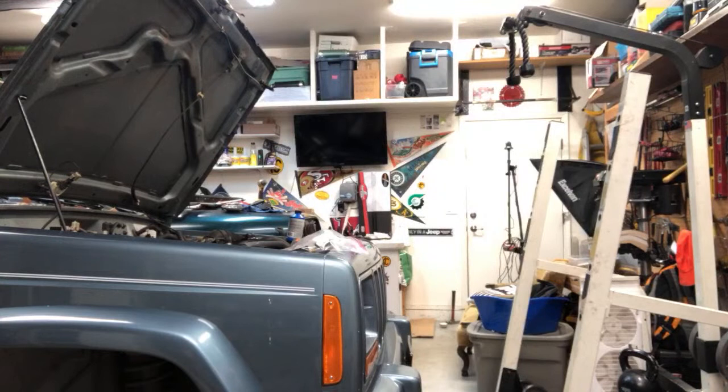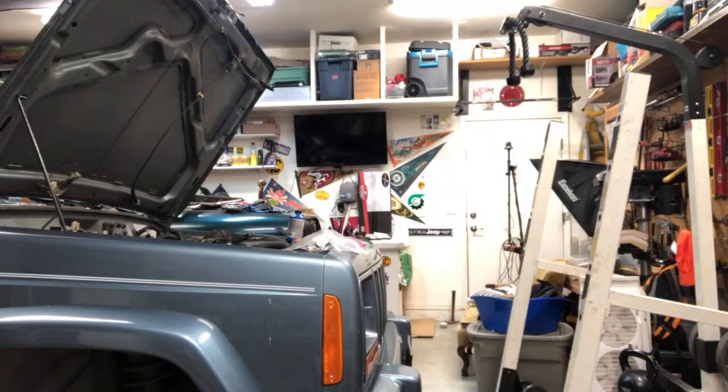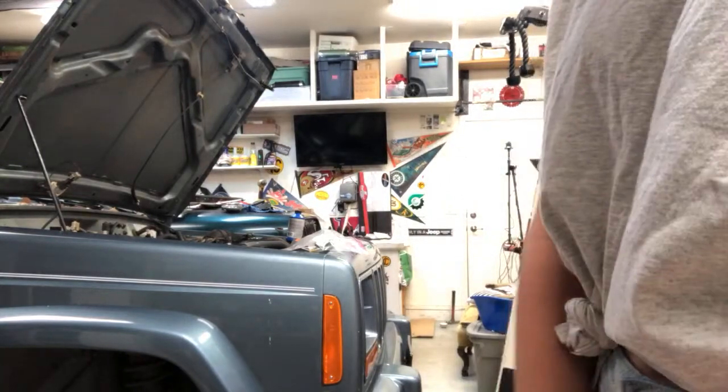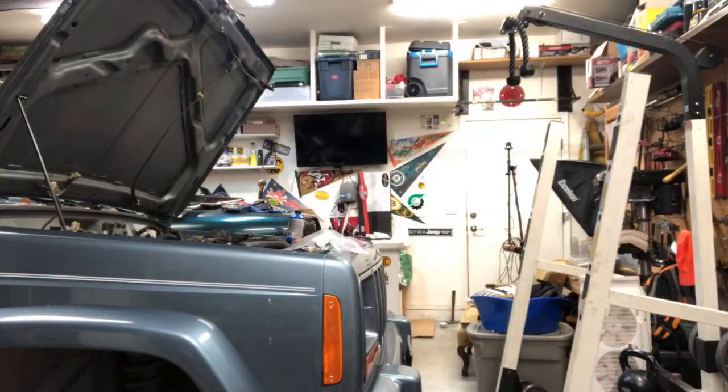There you can see a bubble coming up the tubing. And one other little tip that one of my live stream viewers mentioned was it's a good idea to have your bottle up above and actually have the fluid coming up. So then you can just have fluid up here. It's a little harder for air to run back into your system. So that's a good point. I didn't have a great place to set this bottle, but I did manage to squeeze it in on top of the leaf spring there. So that'll work.